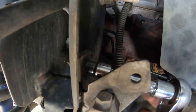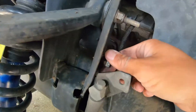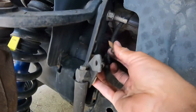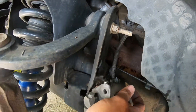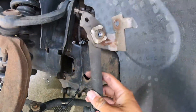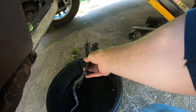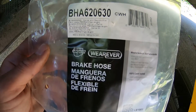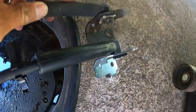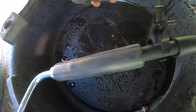We're going to remove the hose, disconnect it from the caliper and from the line, take off the mounting bolt — the 10mm bolt. The line will come out. Here's the old hose. We've got the Weaver brake hose as a replacement. Bracket looks good, everything looks pretty much the same.